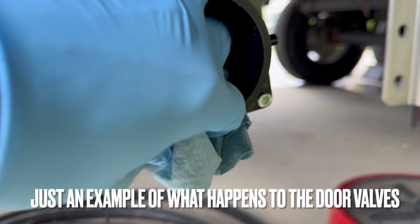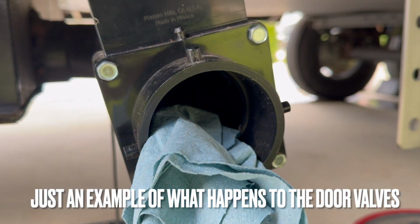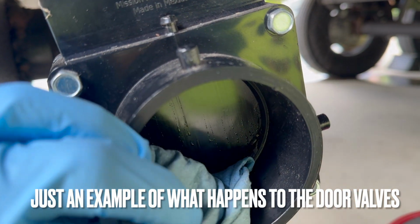and that's going to keep those doors lubed up a little bit, keep them working. Now, even though you're lubing that door up inside there, sometimes that is still going to get blocked. And we all know what goes in the black tank, and sometimes when you open that up and then go to close it again, not everything has come down that drain. There's going to be some toilet paper or something else, and that's getting caught in that gate valve, and it's not seating all the way, it's not closing all the way, and it's going to leave a crack.